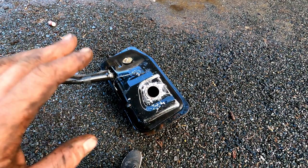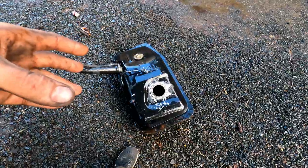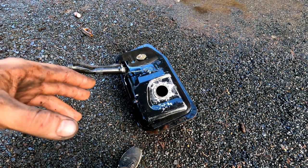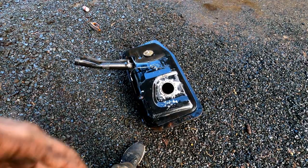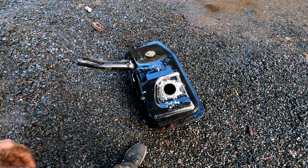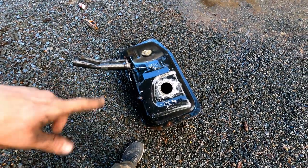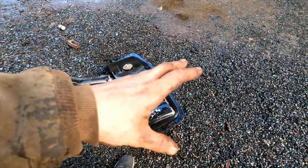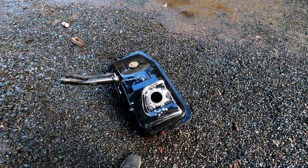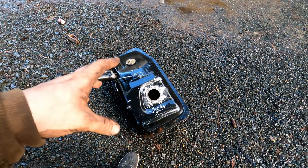What I'll do is get the water out of here and then let it air dry as much as possible. Then I'll probably throw some good gasoline in there — maybe half a gallon — slosh it around really, really good. Wear gloves this time. Maybe different shoes. Get all that water mixed in with the gas and pour it into a can, not just on the ground. Maybe even do that again — spend a whole gallon of it — that way there's no water in the tank, and then you should be good to go.